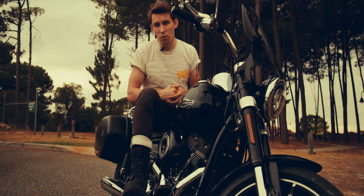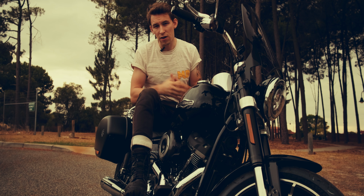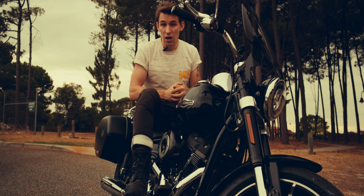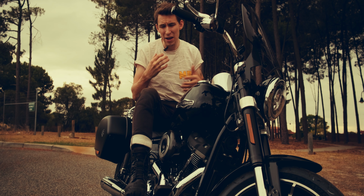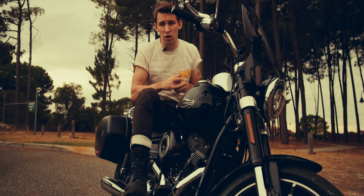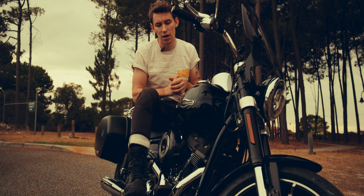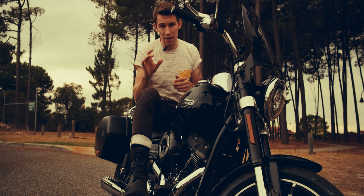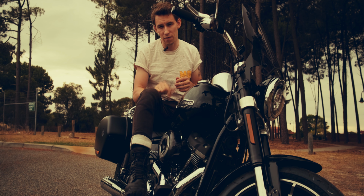So on a first evaluation run, which I didn't get any footage of, the bike was putting out an okay set of numbers, about 97 horsepower, and just over 105 foot-pounds of torque. So this is a little bit lower than what I would expect from this performance cam. I'm expecting about 10% more across those numbers, across the RPM range. But the reason that it's not performing at that level right now was due to some of the results that we found on that dyno tune.